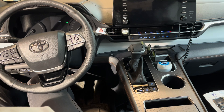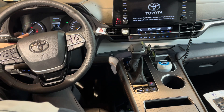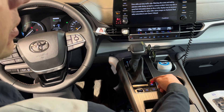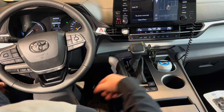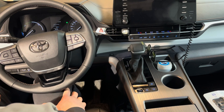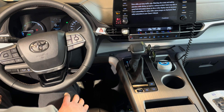Once you're done with the brakes, press the brake pedal a couple of times just to make sure they're compressed. Then turn the ignition on — foot off the brake. You can see the park brake light is flashing slowly. Now take the button and pull it and hold it for five seconds or more until the motors stop winding in. You can see that the parking brake light is out, so now we're back out of service mode. You can turn ignition off, start the vehicle as normal, and everything's back to normal — you can drive it. The rear brake pad replacement mode, or full EPB retraction procedure, is completed.